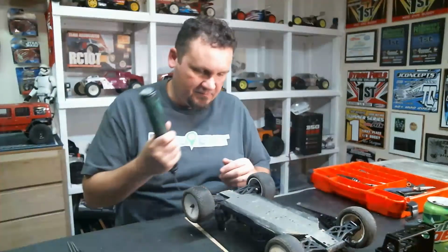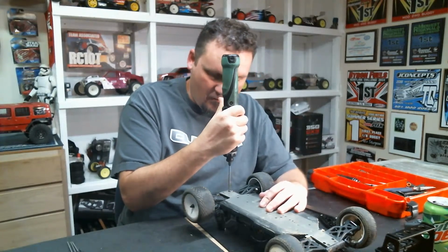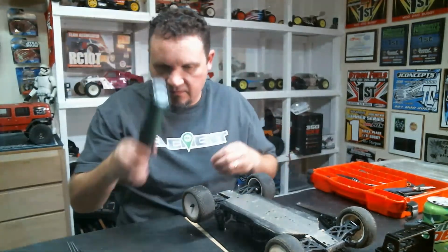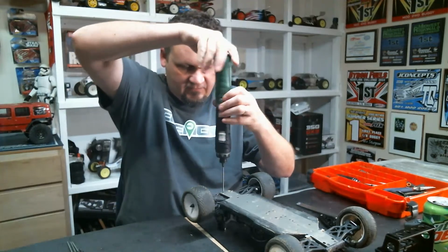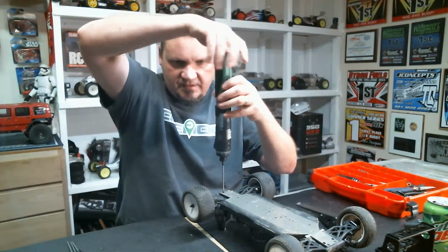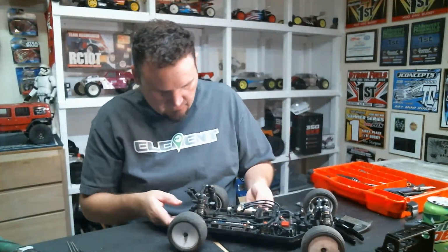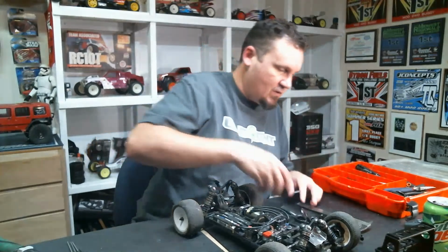But I think that would be a really good starting point. So that's what I would suggest. If I remember correctly, I can't remember the pistons we were using, but I do know that 40 weight oil in the front and 25 in the back was what we used to run, kind of like a standard setup with, I believe, the old silver springs in the front and the green springs in the back. But something like that would be like a good starting point for sure. If I had that car, that's what I would do.